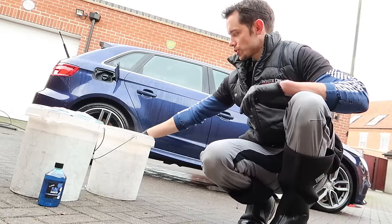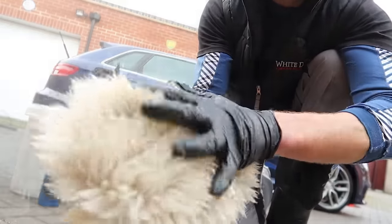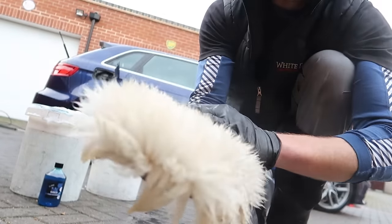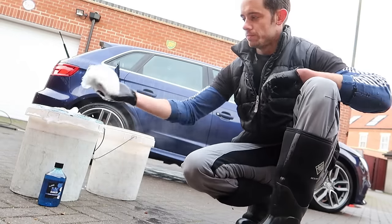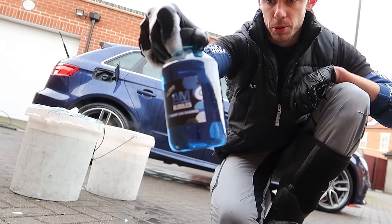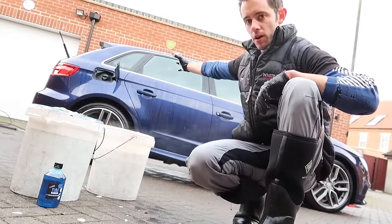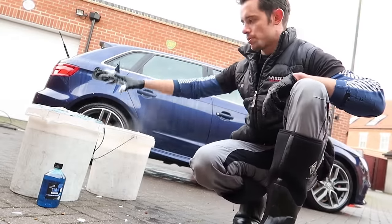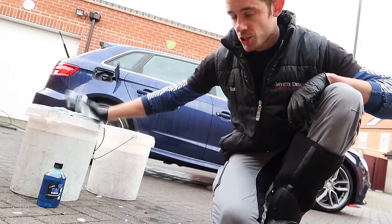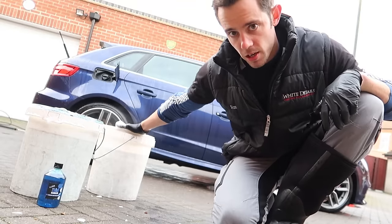The idea of the two bucket wash, this is your sponge, essentially a merino wash mitt, so much more forgiving and absorbent. So if you do pick up any stray contaminants on the surface, it's absorbed away from the paintwork. Got your shampoo, in this case a nice wax friendly AM Details Bubbles, shampoo bucket and rinse. Start on the roof, wash mitt, shampoo half the roof and the glass, rinse it off, then the wing and the door, shampoo, rinse, shampoo, rinse. When you finish the car, shampoo is fresh, ready for your second car, whatever else, and the rinse bucket is black, it's full of the dirt.